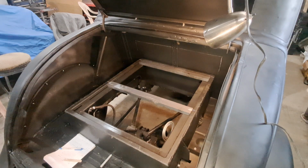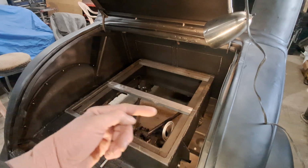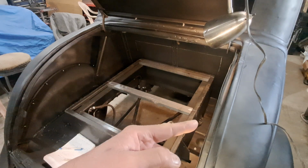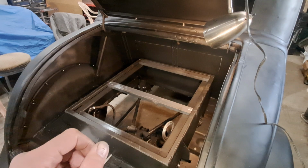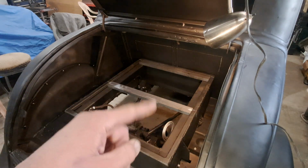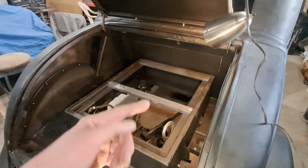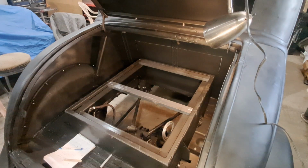What I'll do is I think I'll weld a plate on the side of this. Then we can mount the fuel pump here. And then the fuel pump just has to pull up the tube in the tank across, and then down, because you got to keep in mind, the fuel pump is designed to push, not pull. So the less you can have pulling on it, the best thing, because when the pump is pulling the mass down the tube, the others get sucked up. So then it's easier on the pump that way.